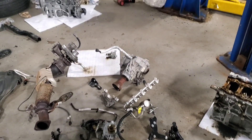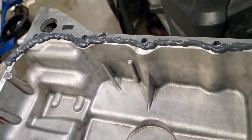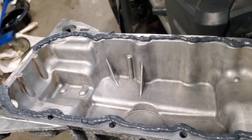So I'm going to go clean all this up and prep the block and go from there. You can see here how I've done it — this is TA-357 silicone. It's all prepped, everything's clean, the block is clean, but my battery's going so I'm going to let it charge for a bit, install this, and put the old bolts back in.